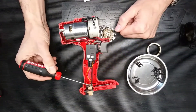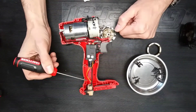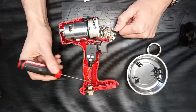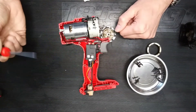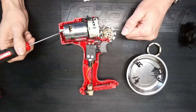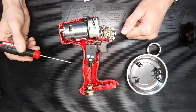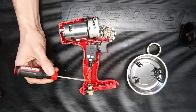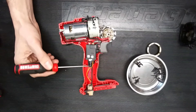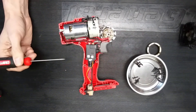Something else to mention: every one of these connection points on the wires — everything is soldered in place, which is nice. You don't have to worry about connections coming loose — nice solid connections between all the electronics. The one that isn't soldered is the motor connection, but from my experience with testing, you don't typically see these connections coming loose, so I think that's fine. Given the way this is probably designed for manufacturing and assembly, this comes in as a sub-assembly between the switch and the terminal block. They drop that into the housing, then drop the motor in and attach the connections. It all makes sense from a design for manufacturing and assembly standpoint.